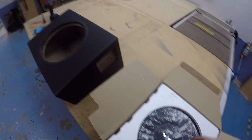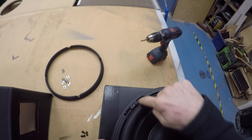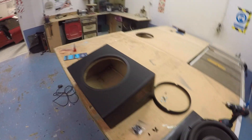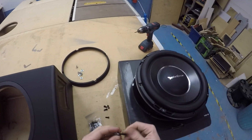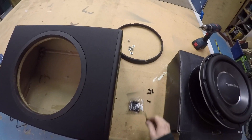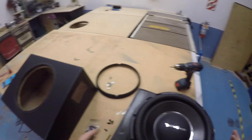I need to figure out what size bolts I can fit through the actual subwoofer. M6 doesn't fit. I need M5 bolts — because the M4 in here just feels way too thin. I could put washers but it just doesn't feel hunky enough. So what I need to get is at least eight M5 T-nuts and eight M5 bolts that will fit under here with the trim ring on.